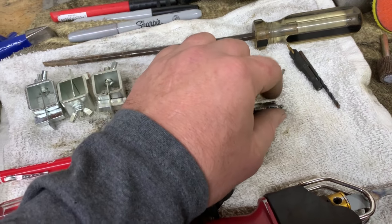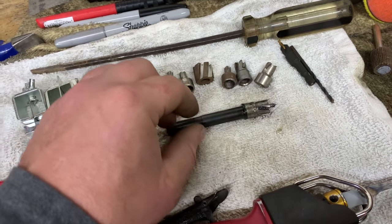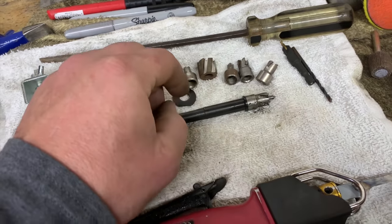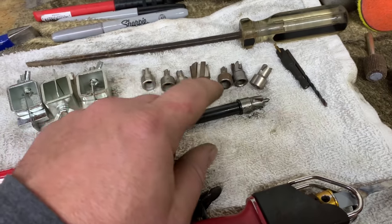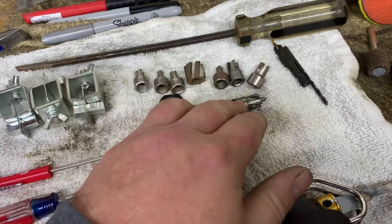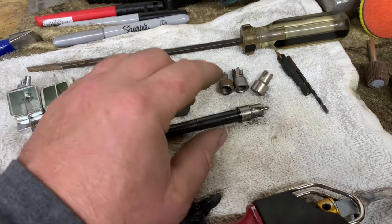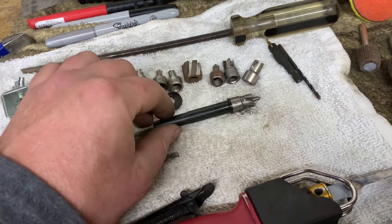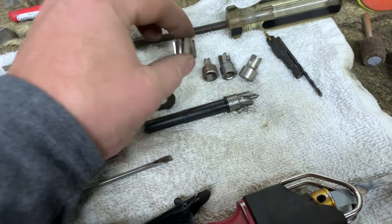They are very brittle. When I had one, I seemed to break it. I'd probably break one or two cutting attachments per job I would do. This tool was actually gifted to me by a friend, so I don't know exactly how much this particular tool would cost, but Matco, Snap-on, Cornwell Tools, and Amazon sell a cutter similar in design to this, and I myself would spend the extra money and get this cutter. The cutting attachments last a ton longer than the cheaper cutters. The cheaper cutters I don't ever seem to have any luck with, but these cutters come in varying sizes, 1/4 inch, all the way to like 3/8.